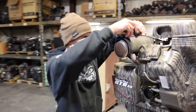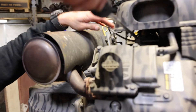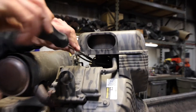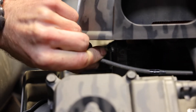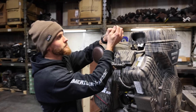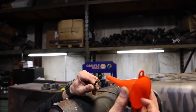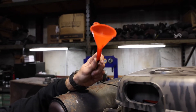We're going to start by unscrewing the cable on the top side — it has to be the top side because if it's not, the fluid isn't going to drip down. So you unscrew the Phillips screw holding it, slide the cable out from the clamp and then out of the holder on the throttle body. Then we're going to slide the rubber cap up towards the top of the cable and slide the cable inside of the funnel.